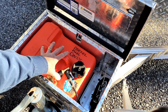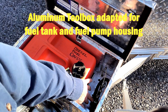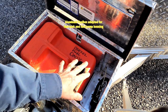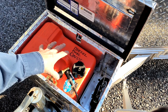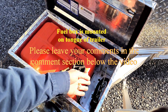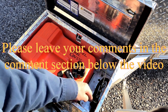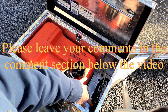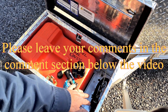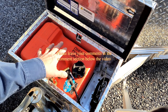This is the diesel fuel tank for the diesel heater inside the trailer, and this here is the pump that pumps the fuel from the tank into the heater metering pump. We put this out here so that we can eliminate the smell of diesel on the inside of the trailer, and it's done a great job. The only thing is, if any of you watching have suggestions on how to insulate these little pumps to quiet them down — we've got a rubber mount here that comes with it — leave your suggestion down in the comments below. I'd be interested to see what some of you have done to quiet these diesel pumps down. But I'm very happy with the diesel heater; it works terrifically.